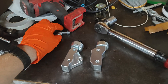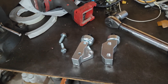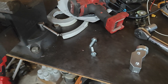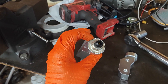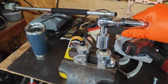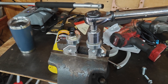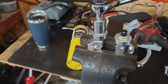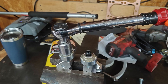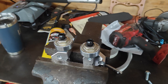If you have a two-wheel drive, the whole job should not take you more than 15 minutes. Here's the hardware you're provided with. Since we're installing the sensors first, we're going to put them in a vise and torque them down to 15 foot-pounds, which is the equivalent of 180 inch-pounds — that's very important. I've got both of my adapter blocks here in the vise together. I'm using an inch-pounds torque wrench up to 180 because I think that's more accurate than my foot-pounds wrench for 15 foot-pounds. Now they're both torqued — let's go ahead and throw these suckers on.